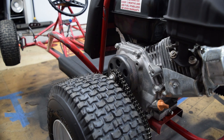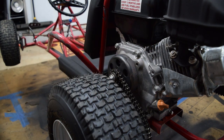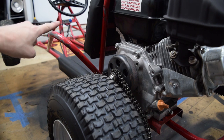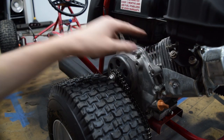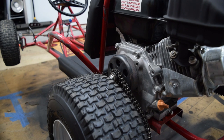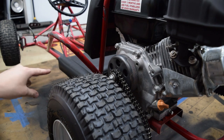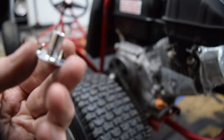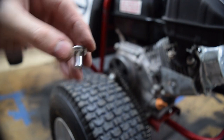I got a little frustrated with the pace and wanted to get this done by the weekend, so I got a bunch done off-camera. I installed the chain, painted the muffler with new hardware, stripped and painted the pedals with new hardware, installed the kill switch, and installed a new throttle cable — the previous owner had cut the adjustability all the way down to the base which was pretty trashy. The seat got reinstalled; the lower portion used existing frame brackets — I marked them on the seat, drilled them out, and put bolts through. It's not ideal but it'll work.